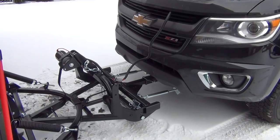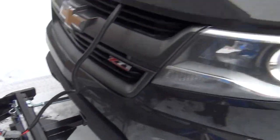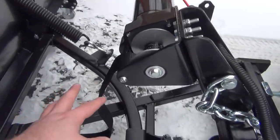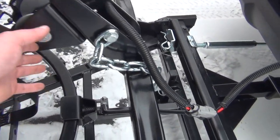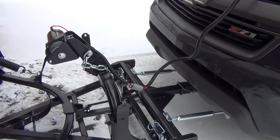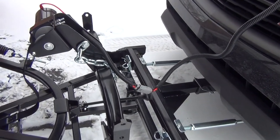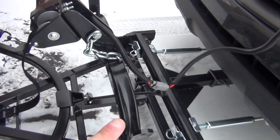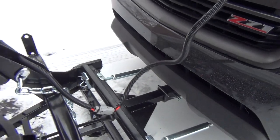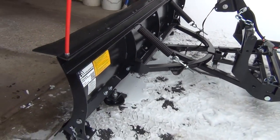Advice time, because I'm new to this too: step one, connect up your power to the winch, start up your truck, and let the winch out a little bit so that you get some slack in the line. That allows this guy to pivot more freely so you can get it into the hitch receiver on the front of your truck. I was trying to just manhandle and pull it, but with too much tension on the line you can't get a good angle. Regardless, we have everything hooked up — I'll go ahead and raise our plow and get our wheels off the ground.